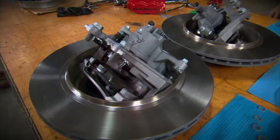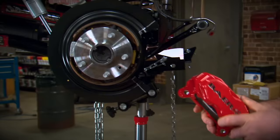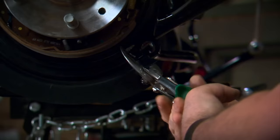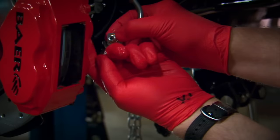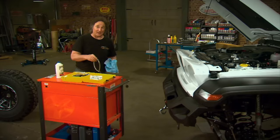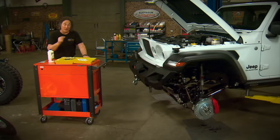The rear brakes are pretty much the same process as the front — remove the stock calipers and rotors. However, the new caliper doesn't quite clear the dust shield, so it needs to be trimmed. You can do this with a cut-off wheel, but the quickest easiest way is with a pair of snips. Then it's just a matter of installing the rotor and bolting on the new caliper. You're going to need to bleed your brakes any time you do something like this, but you also need to spend time seasoning the rotors and bedding the pads — bringing things up to temperature, letting them cool, and doing this several times. Don't skip this step if you want those brakes to work like they should.